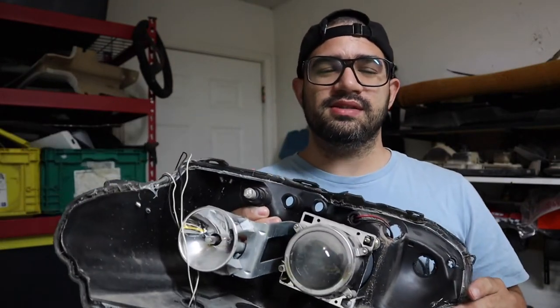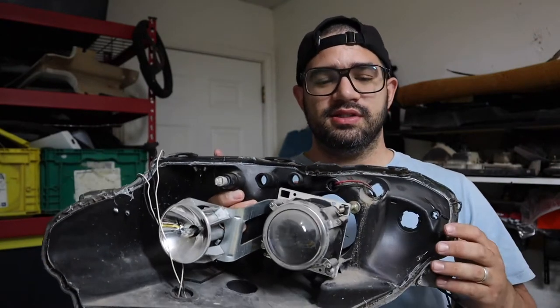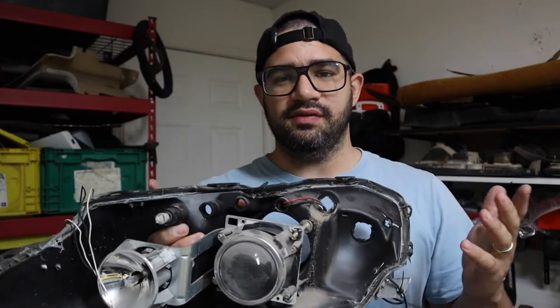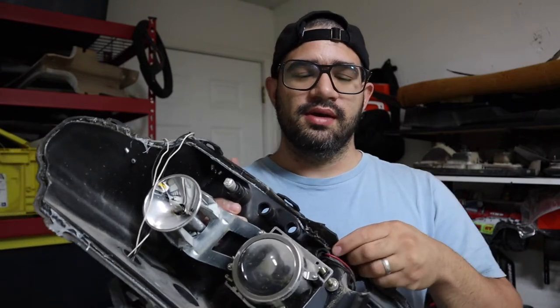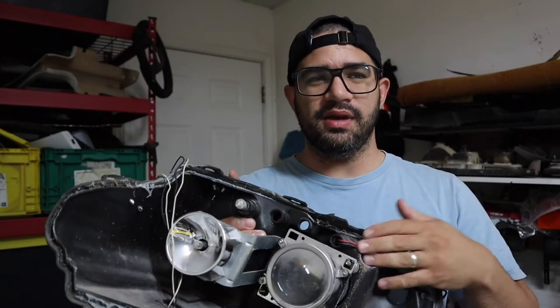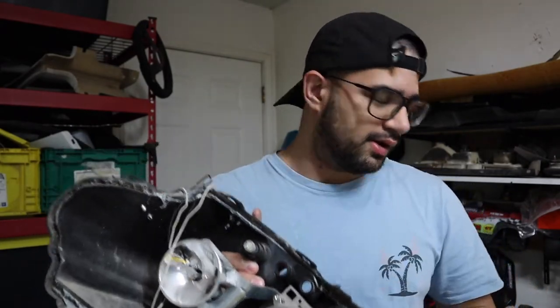I put it for 8 minutes at around 250, and that was way too much time. So I would recommend 5 minutes at 250 and you should be good, because I think this used a little bit cheaper glue. So it doesn't take that much heat for it to come off. So maybe a heat gun I would suggest on this one, because I think it will go a little bit quicker.